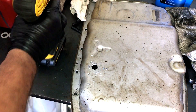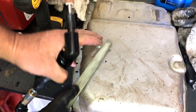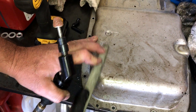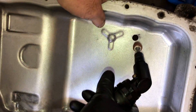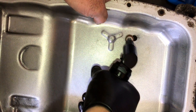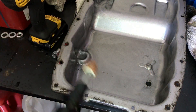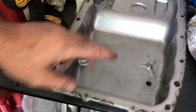Now you've got your drain pan hole. You can take and remove the burrs on this. We're going to remove the burrs — I do the outside flat stuff with just a plain old file. Once I've got the burrs out of there, I flip the pan over and use an angle die grinder. You can use a piece of sandpaper if you don't have one. There's no burrs on it now. Now we're going to clean the pan up.